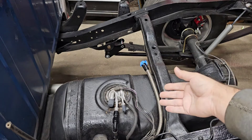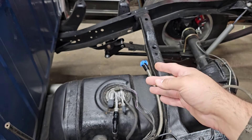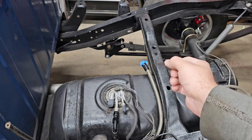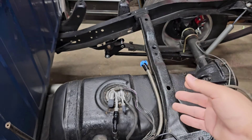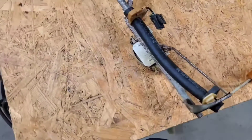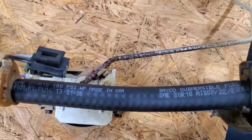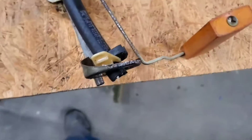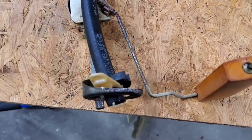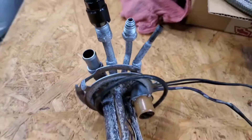As I mentioned, we're going to be using the stock fuel tank and routing the hose up to our mechanical fuel pump - no electric pump, mechanical fuel pump - and that's going to pump fuel to our carburetor. What I've got going on in here is a stock fuel hanger, and what I did was take the electrical stuff off and replace it with a submersible fuel hose from Dayco. From there we have it running to our hard line - I made sure it was the same length so it should be down to the bottom of the float. The gas gauge should be pretty accurate, and we have it running to an AN fitting that converts from the hard line to an AN fitting, and from there we're going to be using 8AN hose up to the mechanical fuel pump.